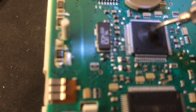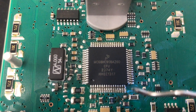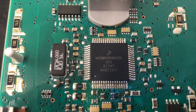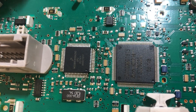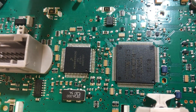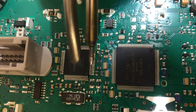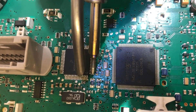It doesn't matter if you drop it because all you've got to do is get it more or less in place. Then the tricky bit is with a correct tool to line these legs up. I'm going to line that up and see if I can get some shots of how we drag solder them. Off camera I've tacked the processor on and held it down just in the corners. I'm now going to drag solder these — it's difficult with this phone in the way, and I've got the fume extractor off because it makes too much noise for the camera.